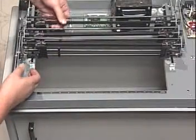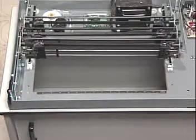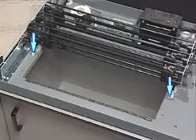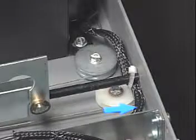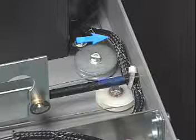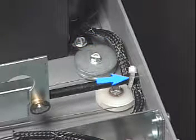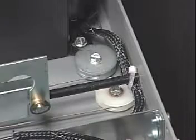Place the left ends of the tractor shafts in the guide slot in the left side plate. Reinstall the screws in the shuttle carriage shafts and brackets. Make sure that the transformer cable is routed under the right shaft and is tie-wrapped to the shaft. Also make sure that the shuttle cable will not rub on the transformer cable.